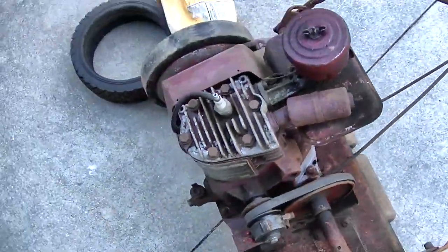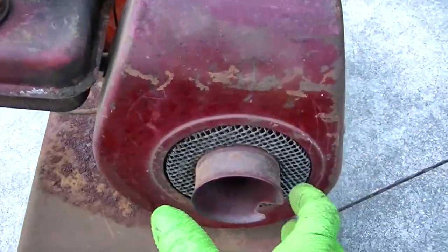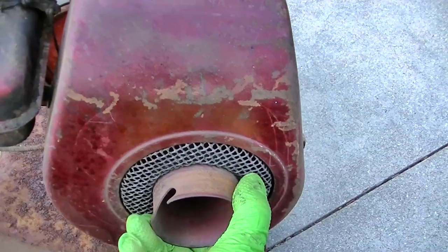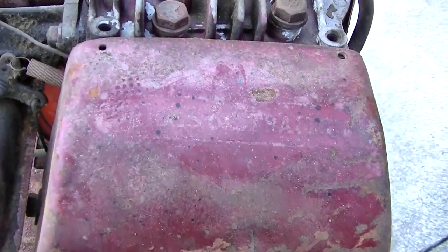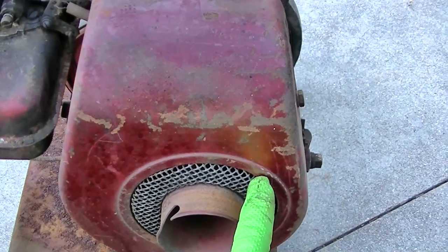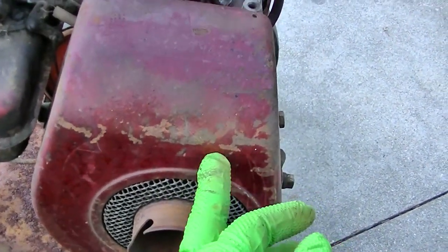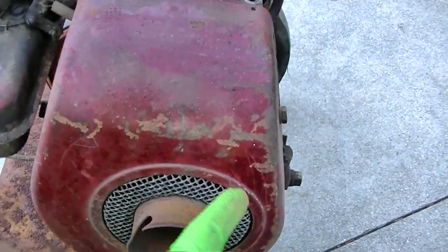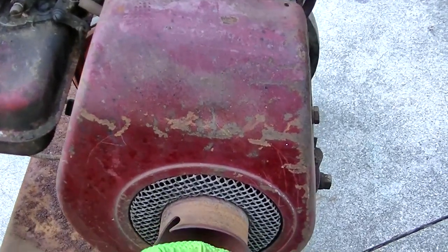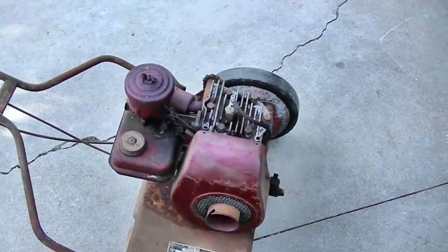There is no compression at all, which by the looks of this I have a feeling it's probably a stuck valve. No compression whatsoever. The Briggs and Stratton label has completely faded away. The other thing I'm a little concerned about is the magnet on the flywheel. There are points in the middle, a magnet, and a coil — that's what makes the spark when the magnet passes the coil and the points open or close. The permanent magnets on those flywheels can go dead; I've seen it before.